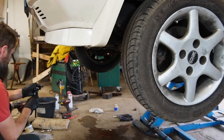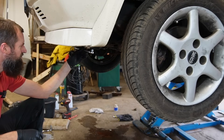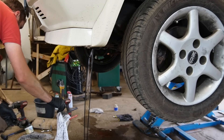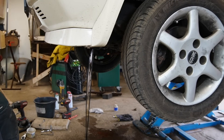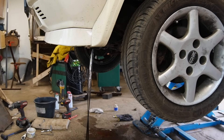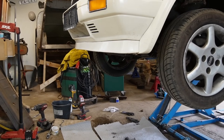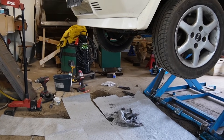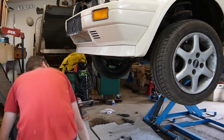I'm draining the oil when it's really hot. It's good to get stuff out of there, but we really need to be careful not to burn yourself. Oh, it's spraying a lot - why is it doing that? What a mess. That's very thin oil. I think it's diluted by fuel. So that made quite a bit of a mess. It was very thin and slightly hot also, and it just came out in a very annoying manner. But no harm done other than a bit of oil on the floor.